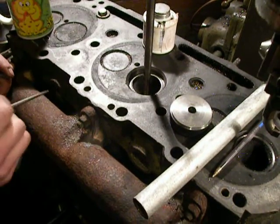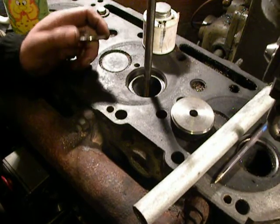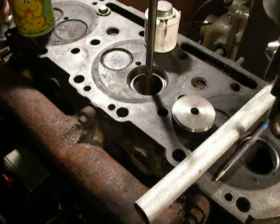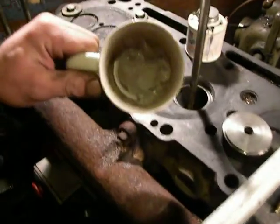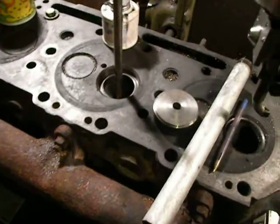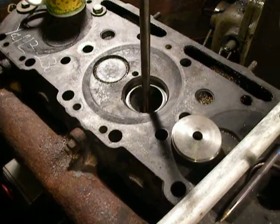Hello, from my factory. I removed the valve seat and made a new one. I cooled it — it's in ice in my teacup — and now I will install it in the cylinder head.